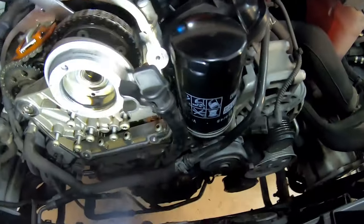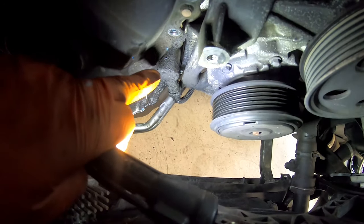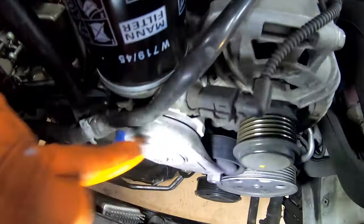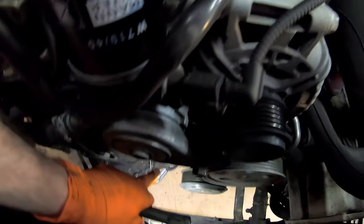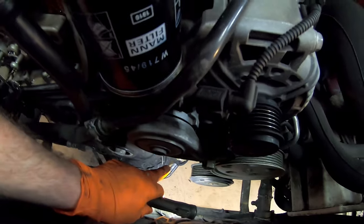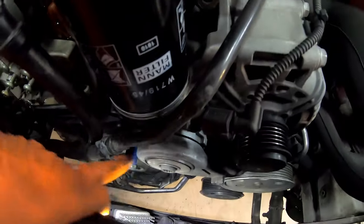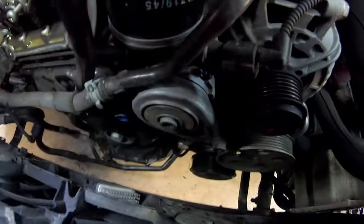There's our control valve - the magnet we bolt off the front pushes into the center of this and that moves the control valve, which changes the oil flow inside the cam barrel of the inlet cam. The Gen 3 of this engine actually has two of these. The way to tell Gen 2 is if it has that solenoid down here for the variable oil pump - if it has that, it's a Gen 2 and it will also have two oil pressure switches: a regular one and a low oil pressure switch for the low stage of the variable pump.